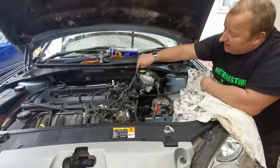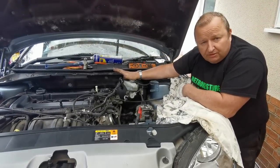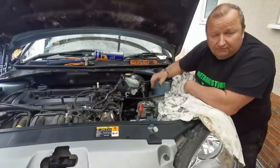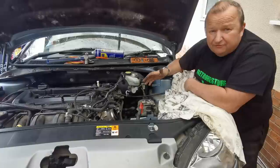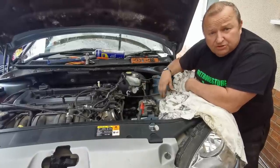We're going to take off the back engine mount. We're going to start to undo the subframe bolts, and we're going to separate the drive shaft hubs from each of the front wheels. And we may have to empty the gearbox of oil because we don't want that spilling out all over the place. So we'll see you in a minute.